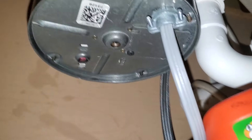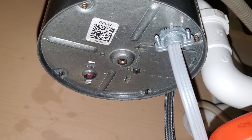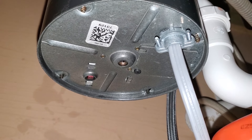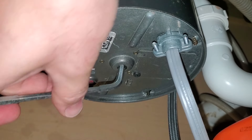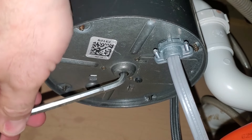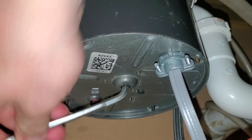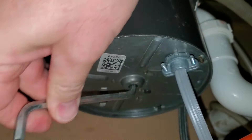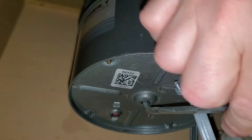And this right here in the middle — that's where your Allen wrench goes, or your tool. It's connected directly to the motor. Make sure the power is off before you do this, because you don't want it to come on and rip the wrench out of your hand. You're gonna work it back and forth to break it loose — you're directly moving the whole insides of the garbage disposal when you do this.